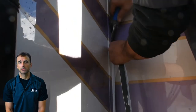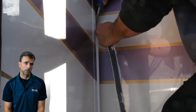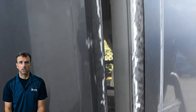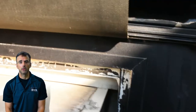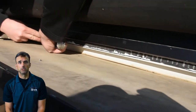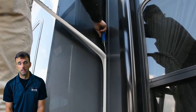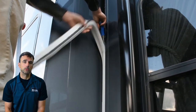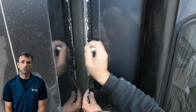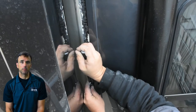I really need to stress the importance of taking your time here. It would be easy to just pull on this particular seal and remove it, but doing so you might rip pieces off and leave a lot behind. It's going to be really important to ensure that all the old adhesive and all the old seals are completely removed. This will ensure better adhesion of the new seal — or in this case, since Greg will be using a push-on, that the push-on component and edge trim won't be hindered from gripping the side of the RV.